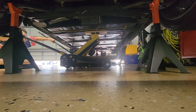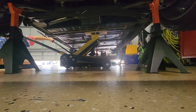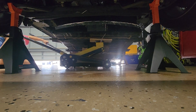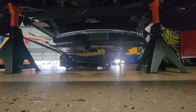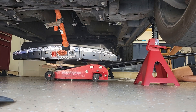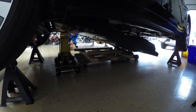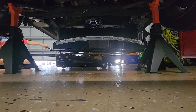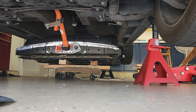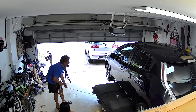With the remaining six bolts removed and the dolly properly positioned, I'm ready to drop the battery. It's best if both jacks lower at the same pace to keep the battery leveled and aligned. Let me also show you another angle where it drops unevenly — it still makes the landing without any problems. The jacks are an excellent substitute when you don't have a hydraulic lift. Now I pull the battery out for the modification replacement process.